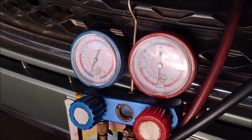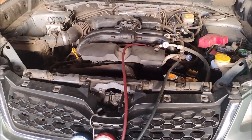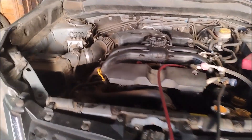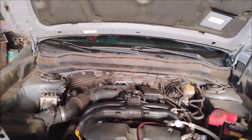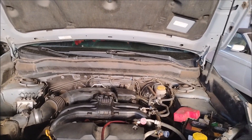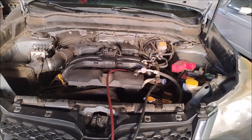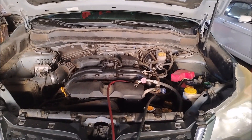The gauges have been holding the vacuum really nicely, so I've reassembled the entire assemblage of the crossmember and the plastic pieces that go with it. Ordinarily I'd be ready to refill the system and bring it up to the correct pressure. However, I have some more repairs I want to do — I want to replace the expansion valve that's back here, and I also want to replace the evaporator which is in the cabin under the glove box, because I detect some smell of refrigerant in the cabin and that means the evaporator is leaking. So I'm going to stop this video here and continue with the replacement of the expansion valve and the evaporator in the next video, as they go together.